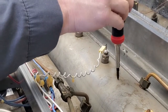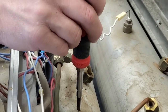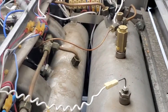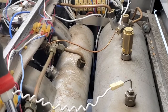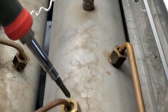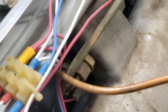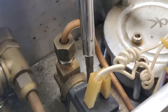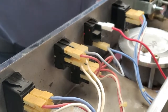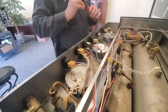You have your steam boiler in the back and your brew boiler in the front. In the Linea Classic you'll only have two brew boilers if it's a four-group. This is just our dip tube for our hot water supply, going to our hot water valve which is actuated by a switch because this is a semi-automatic. On the volume dosing version it'll be controlled by the board based on time, and you can set that time.